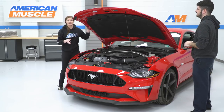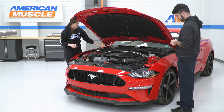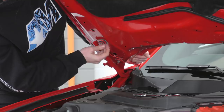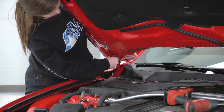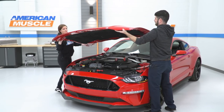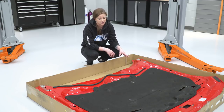At this point you are ready to remove your hood. You'll need a 10-millimeter socket for that, and a second set of hands is really gonna make things a lot easier. We're gonna remove the hood from the hood prop, push the hood up as far as possible, and take our 10-millimeter socket and unbolt the two nuts on either side of the hood. Now we have our factory hood removed and we do have it sitting on a piece of cardboard to protect the paint — you'll probably wanna do the same thing in case you ever wanna return to your stock hood or sell it.